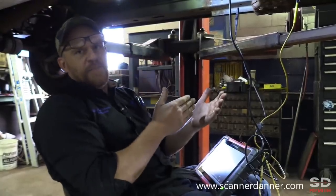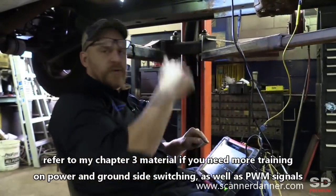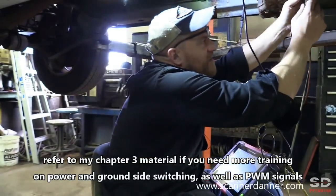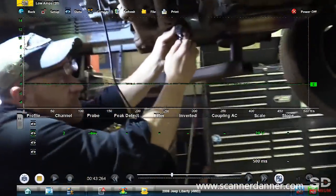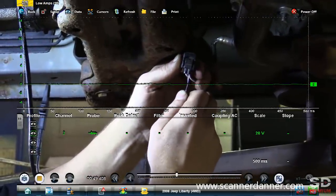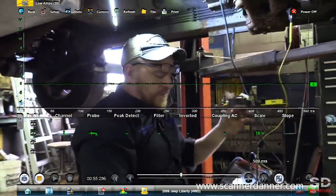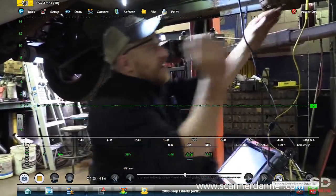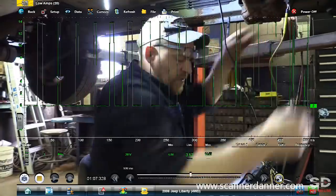If it was ground side switched, when I check this other wire over here it would look the same on the control wire — still zero to twelve because it's pulsing — but it would be constant high. So all I'm doing: switching right there is your control wire, and here's your constant wire. The fact that this constant wire is zero volts — I'll get you a digital number there too — the fact that that's zero tells me the control is power side switched. This is a power side switch circuit.